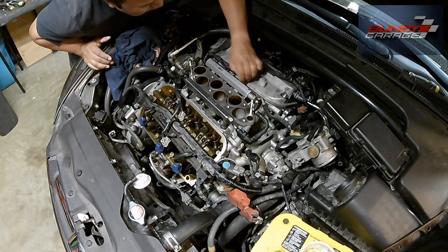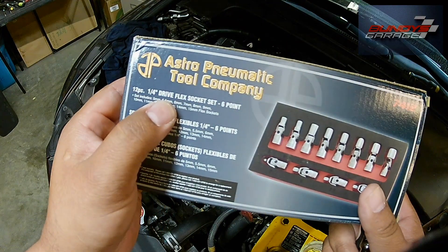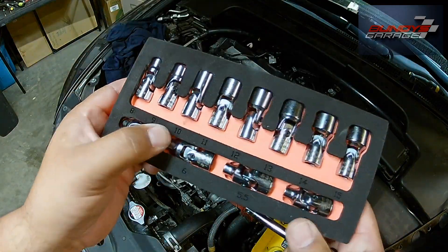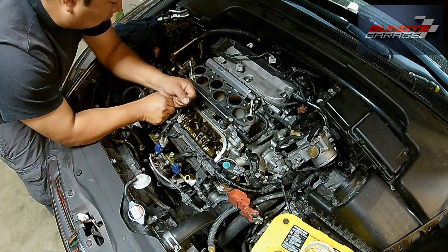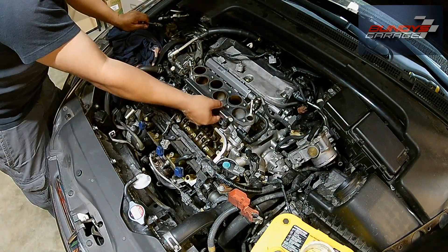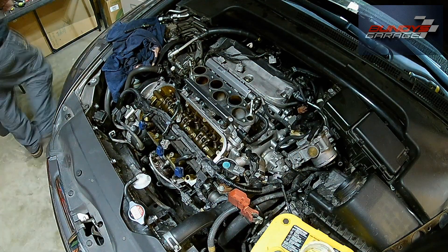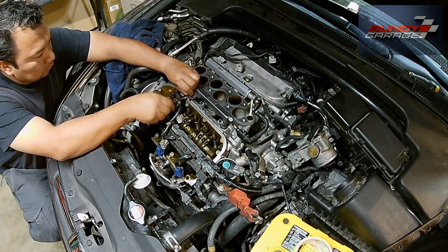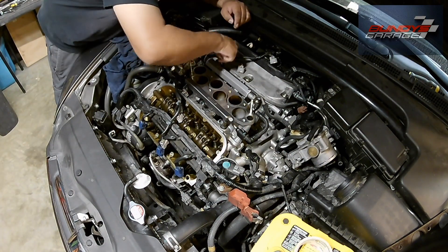Right here I'm working on getting the wiring harness off for the fuel injectors. You have to get those out of the way to get the two lower intakes up. One tool that I use — I'll put a link in the description below — is this Astro Pneumatic Tool Company. It's basically a quarter inch wobble from about 7.5 all the way up to 15. The front ones are easier than the rear ones, and whatever you do, don't drop them back there. If you have a magnet, it makes it a little bit easier.